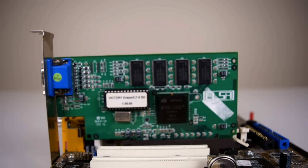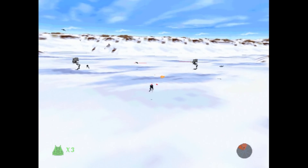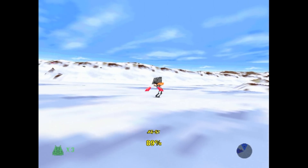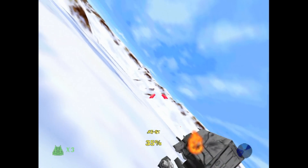In 1998 NVIDIA followed up with the Riva 128 ZX. That card has double the memory — 8MB of VRAM — which lets you run games at higher resolutions. It also has an improved DAC for a sharper VGA output.